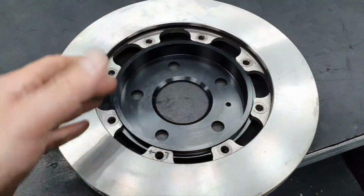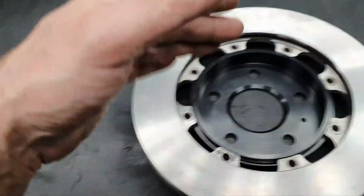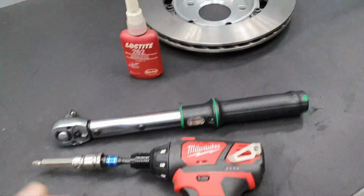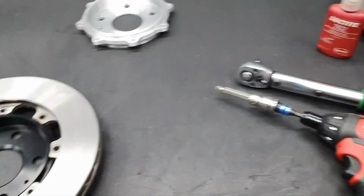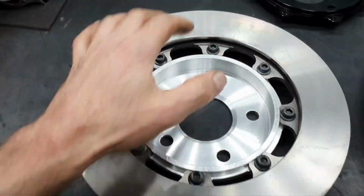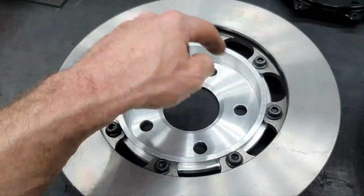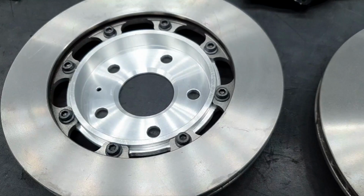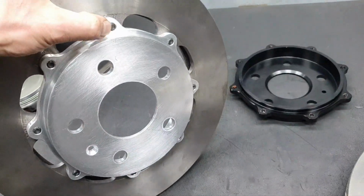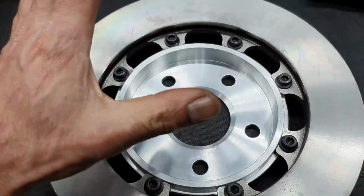Anyhow, I'm following the torque specs. I'm cleaning with the brake cleaner to dry the threads inside. The same thing with the bolts, torquing it down. Yeah, that's it pretty much. Moving on. Now, 30 foot-pounds, torque down in a star pattern. Okay, I was going like this. The threads feel okay. I didn't feel any problem. It torqued down to 30 foot-pounds, like I said, it's fine.